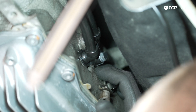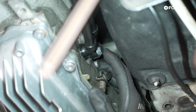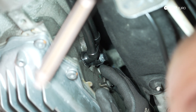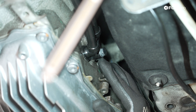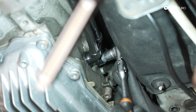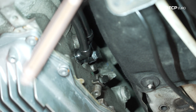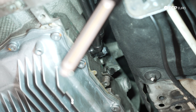Reinstall the 13 millimeter screw. The torque spec is 19 to 23 newton meters, but realistically you're not getting a torque wrench in there. All the screw needs to do is be tight enough to hold the trans cooler lines to the transmission — it's the O-rings that make the seal, not how tight that screw is. This is also a plastic connection, and even though there's a steel sleeve in there, you could start to deform the sleeve which will crack the plastic. So we're going to take a quarter inch ratchet with a 13 millimeter and snug it up. Torque specs are great, but sometimes it just doesn't work when you don't have a lot of room. Use some common sense and you'll be fine.